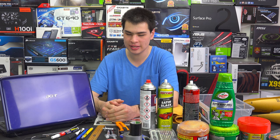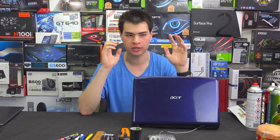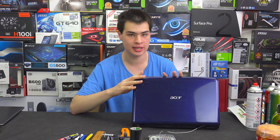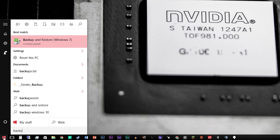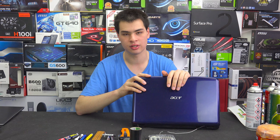Before we get started pulling our computer apart, we want to make sure everything is backed up, because there's a chance of something dying and we don't want any data loss. Grab yourself an external drive or a server and make a full backup of your C drive. Windows 10 has an awesome utility that allows you to back up the whole system, or you could use imaging software such as Acronis True Image. Simply search for backup in the Start menu, open the Windows 10 application, and follow the on-screen wizard.